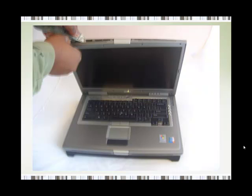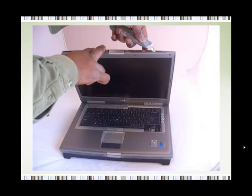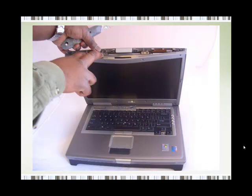What you should be doing is using your fingers to assist the process. So don't use a knife to prise away. In fact, by using a knife, you are probably going to damage your laptop screen or even damage the bezel and make scratches, I should say, on your laptop. So step eight, as you prise apart the front bezel with a knife, use your fingers, as I said, to gently assist the process until the bezel is completely free from the display.